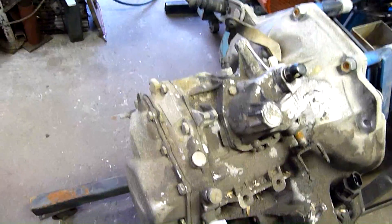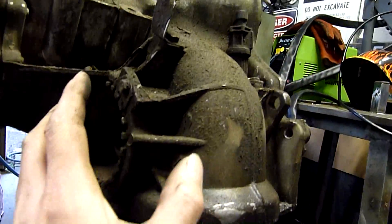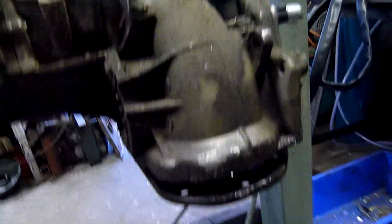Let's start removing bits. I'm going to remove sensors and start by removing this back plate. The transmission is empty of oil. That's the differential, of course - on a rear-wheel drive car that is completely independent and separated by a tail shaft assembly. We'll get into that later.